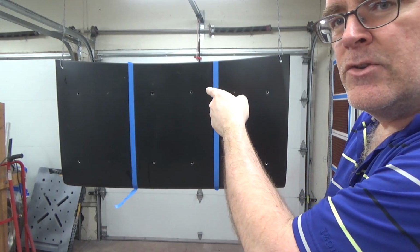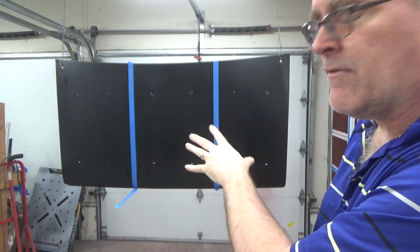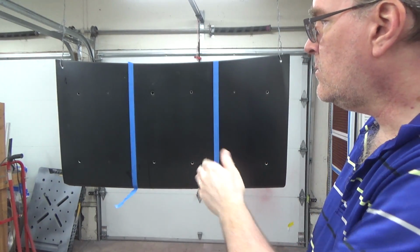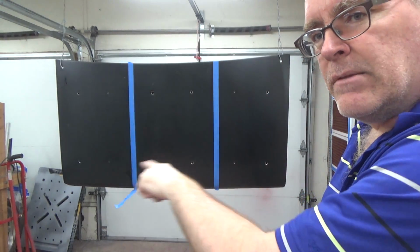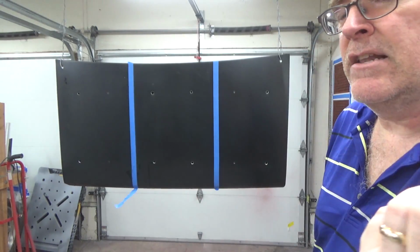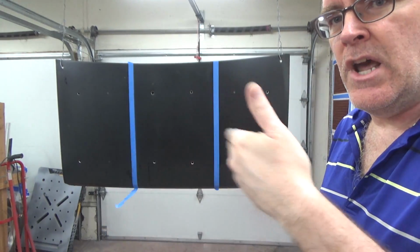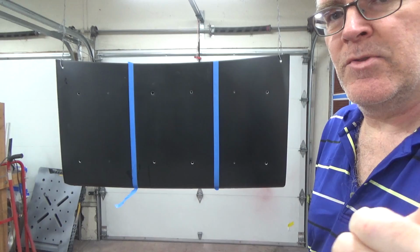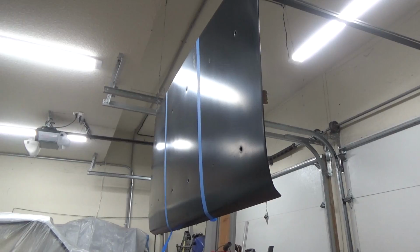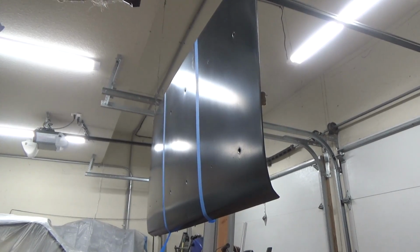The top panel, I'm going to try and shoot for a medium wet coat, 75% overlap, something like that. The bottom half, I'm going to go for a wet coat. And again, we'll have all these different places on this panel that we can look at and see, does the accelerator make any difference? Is it too much? Is it not enough? Etc. We're going to give that a shot. So we're going to mix up some clear first. All right, we're going to try and get the camera down nice and low so you can see the reflections of the lights and see how the clear is going on.